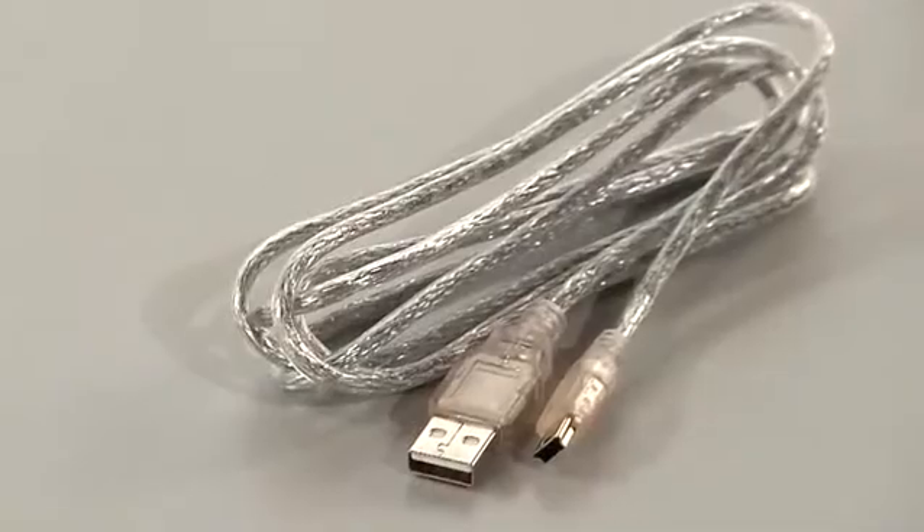If at this point the lights on the tablet don't come on, my first suggestion would be to try any other USB port. If that doesn't work, since it's more likely that a cable will fail than the tablet itself, try any mini USB cable like the ones that come with most digital cameras.